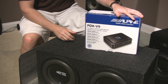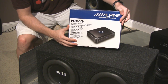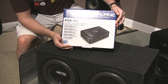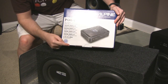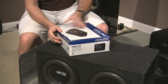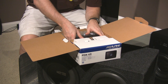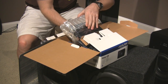So I don't have those other amps anymore. I still want great sound quality for the money and a more simple system, but one that can still be tuned to competition quality. This is the one I went with — this is Alpine's new PDX V9, the newest of the PDX series amps. It's a five-channel amp. Rated power is 100 watts by four channels, then it has a subwoofer output channel as well for 500 watts mono. Included in here was actually a birth sheet, and the actual tested wattage was 137 by four and 581 for the subwoofer. It's a juicy amp, and I think that's going to be pretty good for my setup.